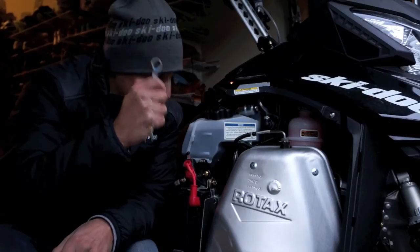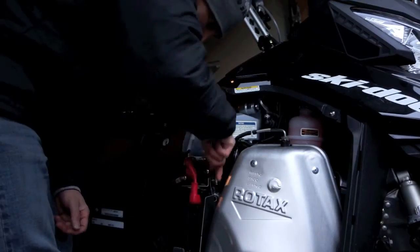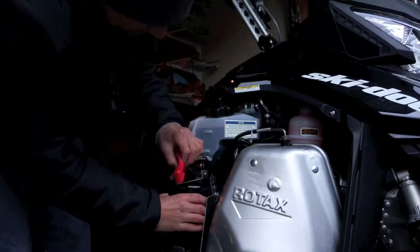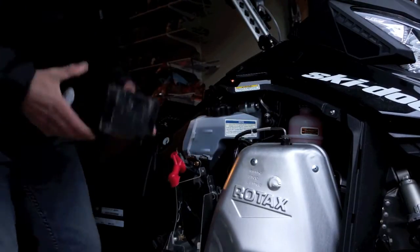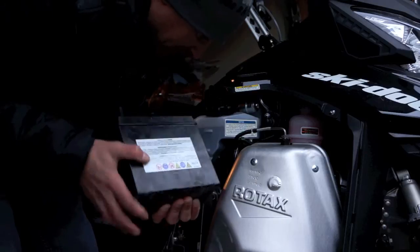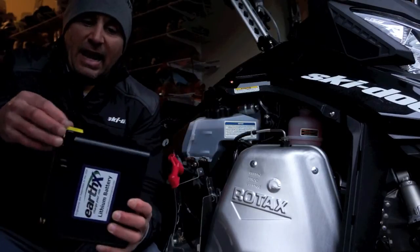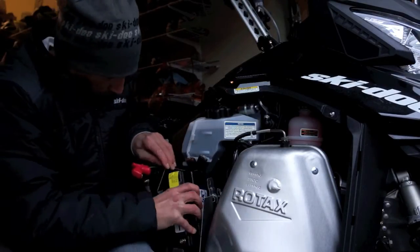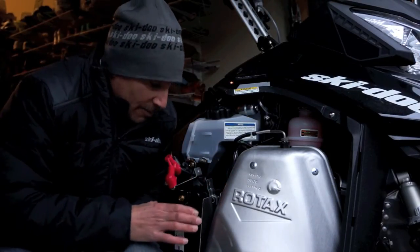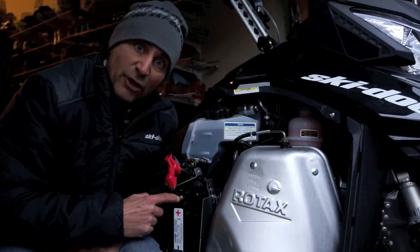The first thing you're going to do is take your 10mm and take out the battery — unplug the positive and negative terminals. Now that we've got the lead-acid battery out, you can take that out and use it as a door-stopper for the rest of its life. We're going to take the Earth-X and install it. The Earth-X battery fits right in. Before I do all the bolts, I'm going to remind myself to attach the positive terminal to the battery first before the negative.